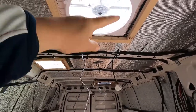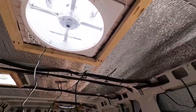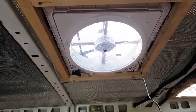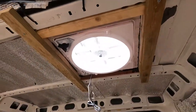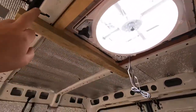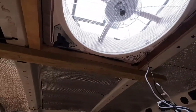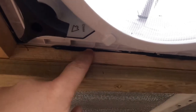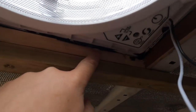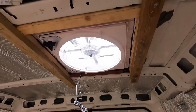This one at the front here is the one you saw me install — we've got a nice wooden frame on the inside, it's been leak tested and is all A-OK. The one at the back is exactly the same with a wooden frame. I just need to take these supports off which were holding the frame in place. If I come in closer, you can see the Sikaflex 221, the real sticky black stuff, just splodging through on the inside — which is absolutely perfect and what I wanted. So I know that's got a good seal.